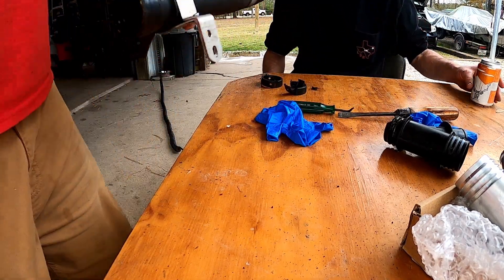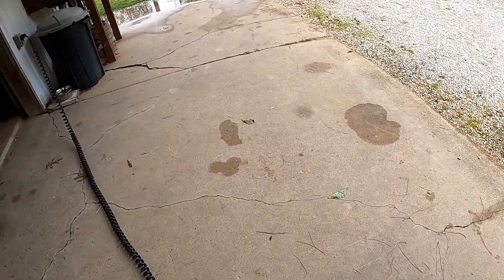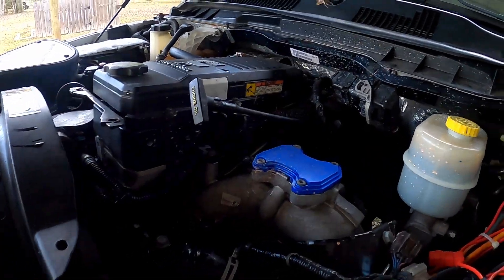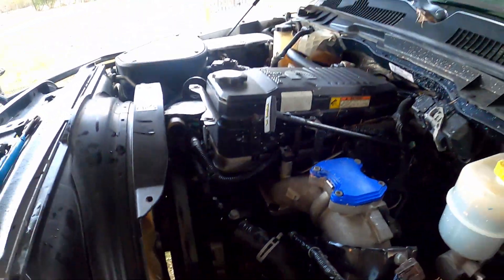We'll go put this back on. I didn't really give you guys an introduction, but I had a leak from that Y-pipe. The plastic Y-pipe leaked on the top upper radiator hose. It started leaking bad today. I already knew it was going to leak, so I bought a metal one to replace it when it did start leaking. I popped the hood today and you can see all this coolant — all this red, dried-up coolant. So I'm going to go ahead and put you on the timeline while I put this back on.